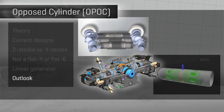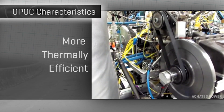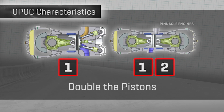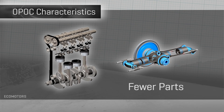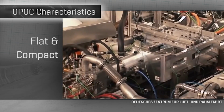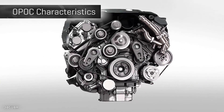You're likely to hear more about these engines in the last half of this decade, so here are four concepts to bear in mind. They are more thermally efficient because they don't have a heat-sapping cylinder head. They have doubled the number of pistons in a cylinder to pursue more power-generating devices in less space. These are engines that seek to have fewer parts and therefore less weight, and their generally flat packaging is something car makers are interested in, as opposed to traditional tall, bulkier engines.